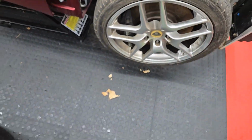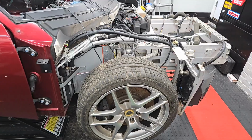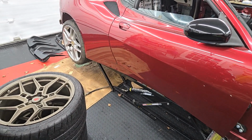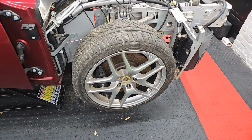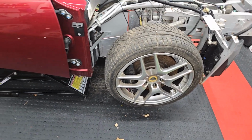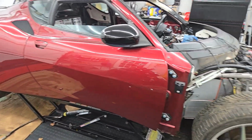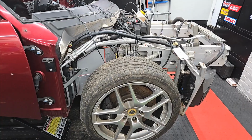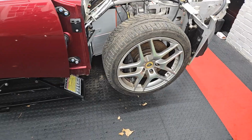So we'll see. But anyway, spec-wise, what you're looking at is from front to rear. They're 18 by 8s on the front, and then they're 19 by 9.5 inches on the rear as far as rim specs. And then you got 225/40 on the front and 255/35 on the rear. The front tires are 21 pounds, the rears are 27. So not the lightest, but that's not too bad, right, considering the size of them.